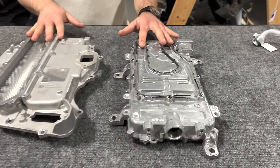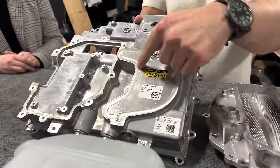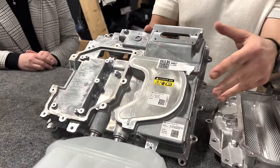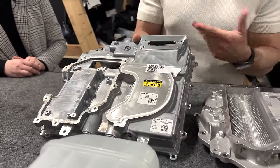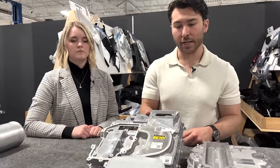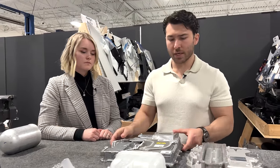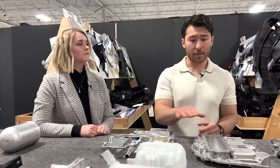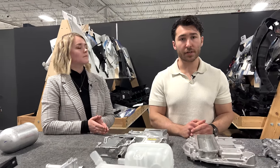As opposed to doing something like that, they've actually friction stir welded on a closeout plate. So they've effectively eliminated fasteners, integrated the cover for this into the inverter housing itself, because effectively there's no reason to need to remove that or service it if it's purely providing a channel for coolant flow. So that was one thing that stood out to us as comparatively a pretty unique execution between the powertrain component cooling between some of these vehicles.